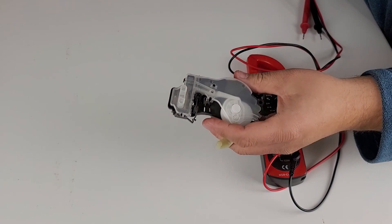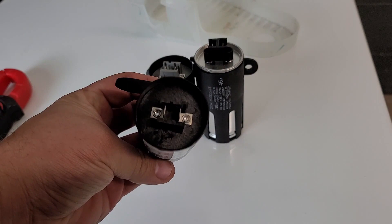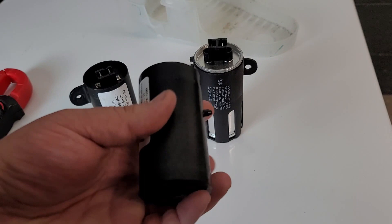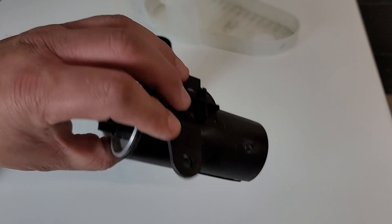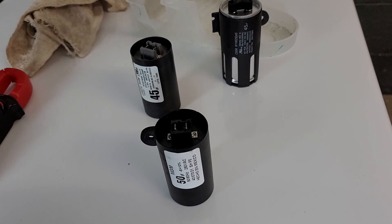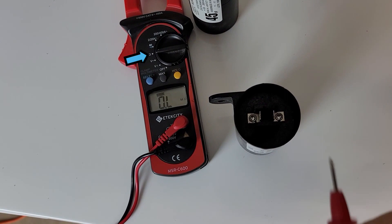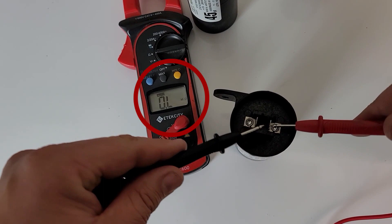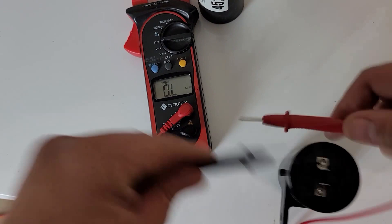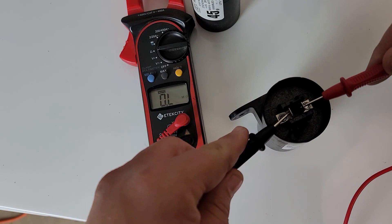When it comes to capacitors, the best way to discover a bad one is visual inspection. Most of the time when a capacitor has gone bad there is physical damage and it's warped significantly in one area. There are three types of capacitors you could see on a washing machine and they all pass a visual inspection here. Before testing with a multimeter, discharge the capacitor by touching both metal leads with a screwdriver — you may see a spark or hear a pop. Make sure the screwdriver has a plastic insulated handle. To test with a multimeter, set it to ohms resistance — the resistance should increase until it goes back to OL or open line. If you have a nicer multimeter there will be a specific capacitor function that will tell you quickly if it works. The ohms test is very inaccurate, so if you have the cap test function it'll make this step far more definitive. There's a link to a nicer multimeter in the description.